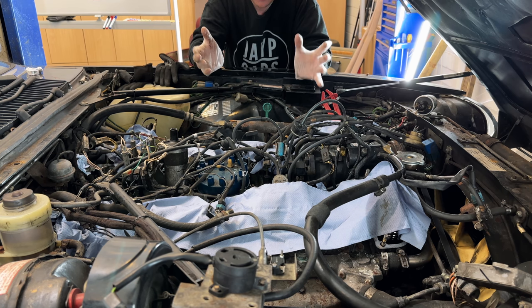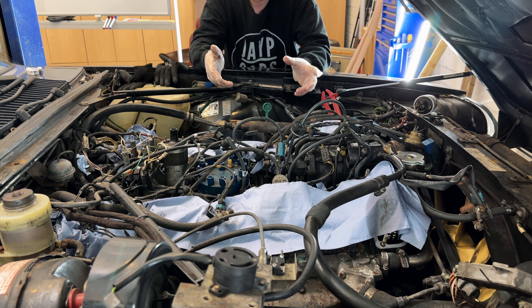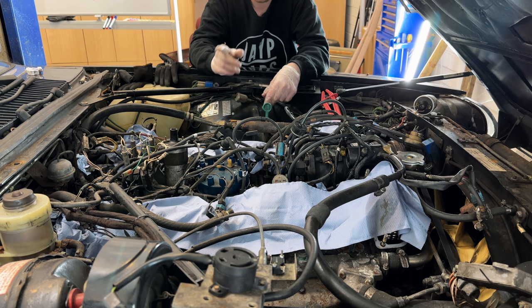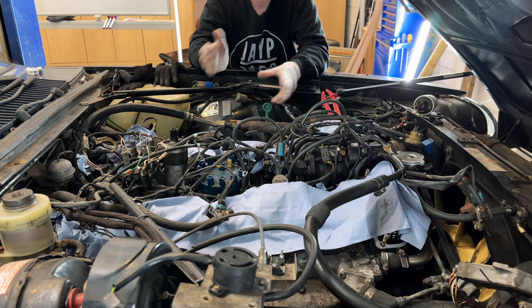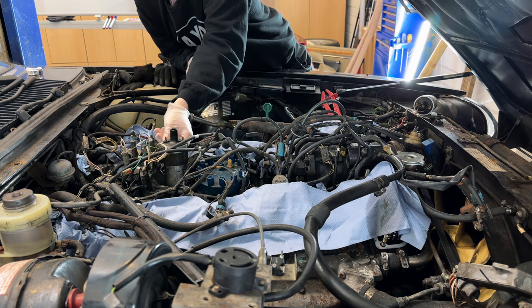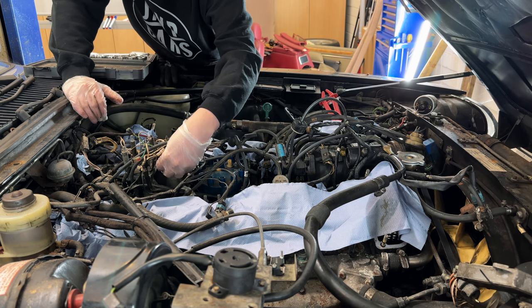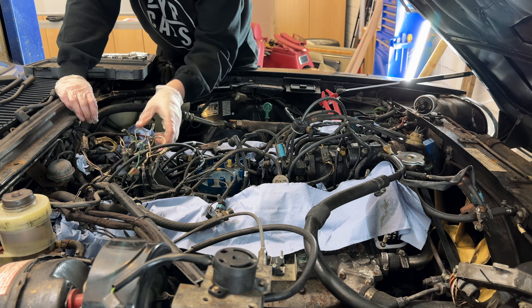I'm thinking it might make sense to start taking some stuff out of the centre to try and make a bit more room and also to clean it all out because it's extremely dirty in there. I think I'll remove the coil first - that looks nice and simple. Take the leads out - it will just give me a bit more space to work with. I'm not going to record all of it because I know how to put it all back. So this coil here, one screw out. This has definitely been the biggest job I've ever done on a car.